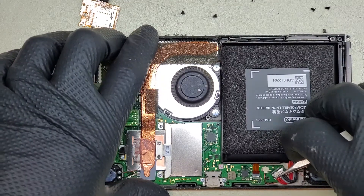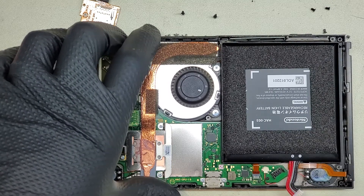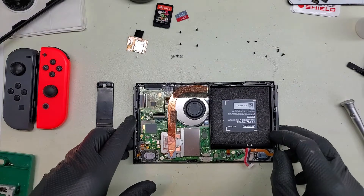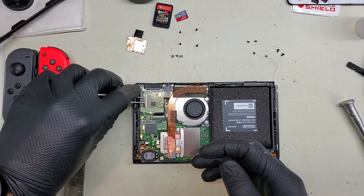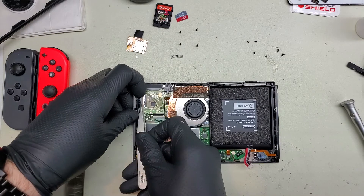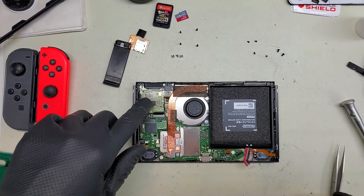Next I'm going to disconnect the battery. Usually you would want to use something that's not metal to do this. I've done this a few hundred times so I'm very careful and aware of where my tweezers are going. You want to put something under there and pry up and out to release that battery connector. Now we can safely start disconnecting things from the board without any other risk. Then we're going to want to disconnect the LCD connector and digitizer connector. We're going to pop open this little flap style flex connector very carefully - we do not want to snap this. Just kind of work it out. You don't want to give any kind of pressure on it that's going to cause any rips or tears. Got that part disconnected.